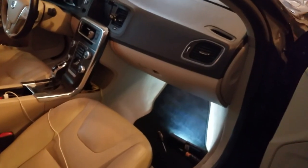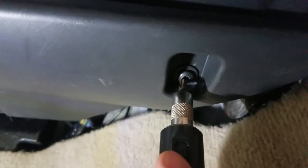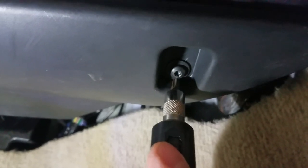We're looking in the car at the passenger side underneath the glove compartment. I want to get this out of the way because I know I have to peel back part of the carpet there and this is going to be in the way, so let's set that off to the side. Now up under here, this is the glove box. Under here there's a plate that has two screws — here and over on this side — that's two T25 Torx. We're going to have to remove those and drop that plate down. The hardest part is working in here because you've got to be super flexible. Let me get these screws out real quick and we'll pop that plate out.